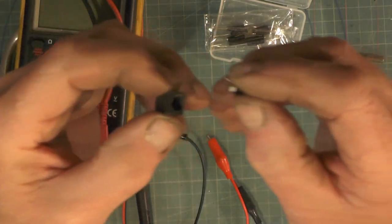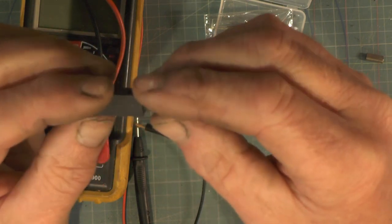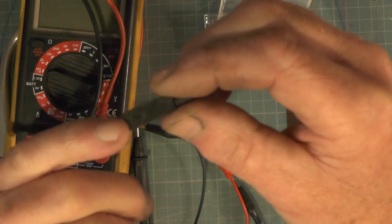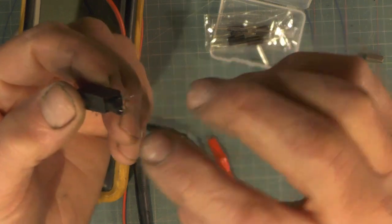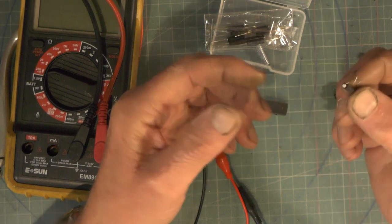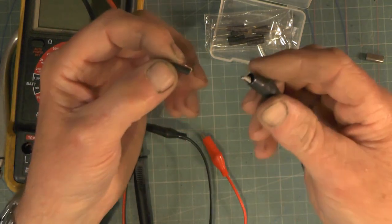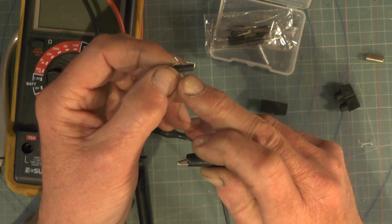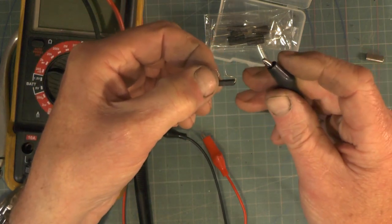What I'm going to do is solder some wires onto my reed switches, push the reed switches into the plastic block, then just put a little bit of adhesive at each end just to seal it in. For anybody that's never seen these type of switches working - all it is, there's either a normally closed or a normally open switch. These are normally closed.